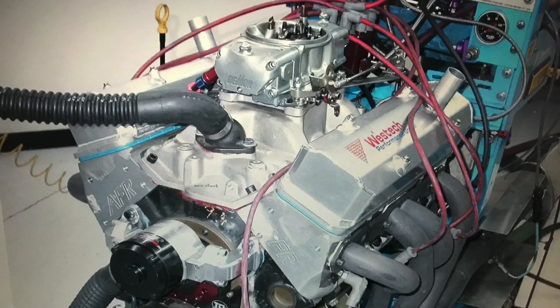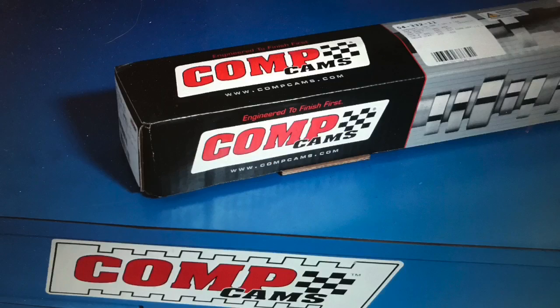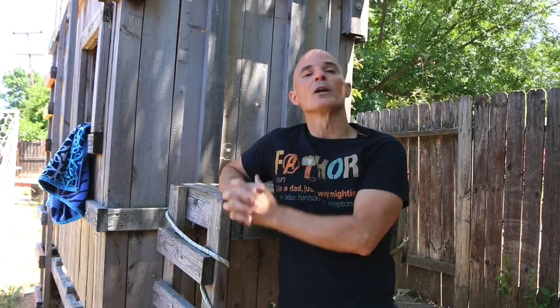What about the carbureted stuff or that Stealth Ram we tested? If you want power up at higher RPM, pick something like that 268 cam. Cam the combination to run at the desired RPM. You want more top end? Pick a cam like that. Also your induction system — you want more RPM? Pick the induction system that suits where you want to make power. I'm Richard Holdner, guys. Thanks for watching.